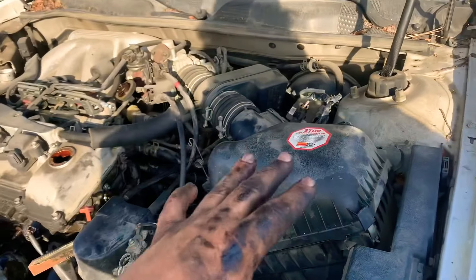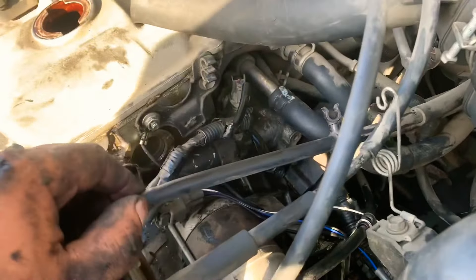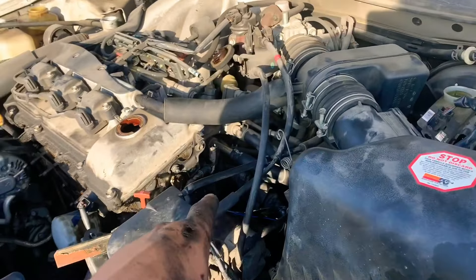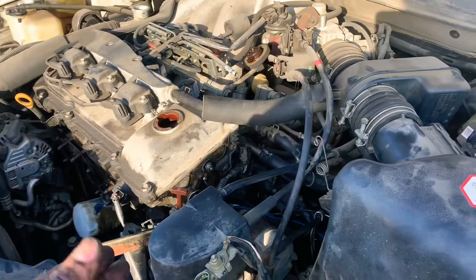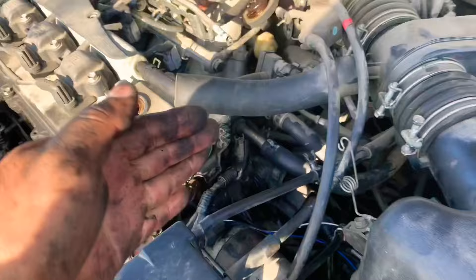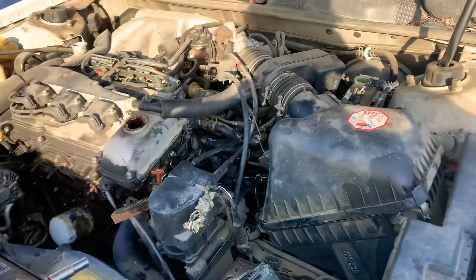We put everything back on the air box, tying everything, making sure everything is connected. This is an idea of how to replace a thermostat on a six cylinder Toyota engine. It can be really easy if you take your time. Remember, you've got to remove the air box to get to it, then slowly unplug your sensors, undo the hoses, and undo the three housing nuts that hold it. Slowly work yourself out, replace the thermostat, and it should be easy. Hopefully this video was useful — this is how to replace a thermostat on a 2000 Toyota Camry V6, and this also applies for the Avalon. We'll see you soon with more videos here on channel Jose.